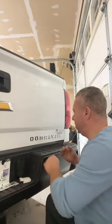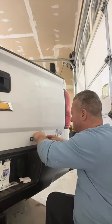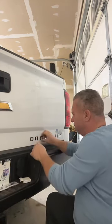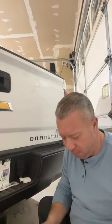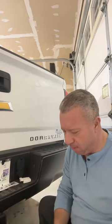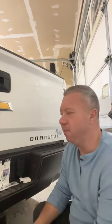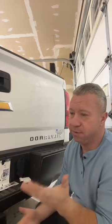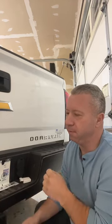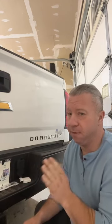Yeah, so Big H, S&S Detailing, they were talking about heat gunning and plastic razor blades for pinstripes. It does that, or a 3M wheel works well. One thing about pinstripe removal, and Big H and I talked about this when he was doing his recently, is you do have to be careful on some older cars. If pinstripes have been on paint for a very, very long time, you'll actually get where it's eaten into.